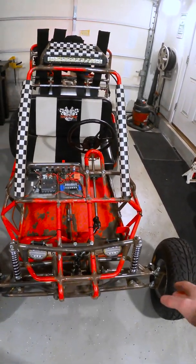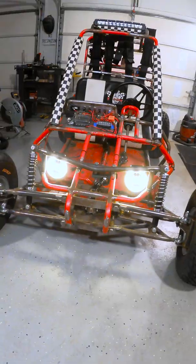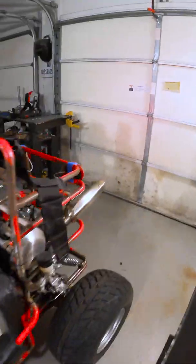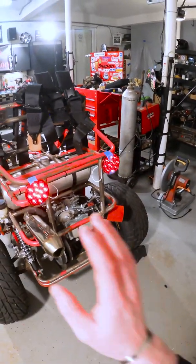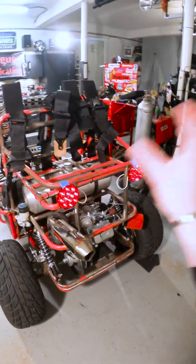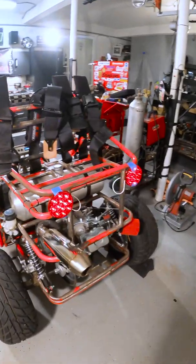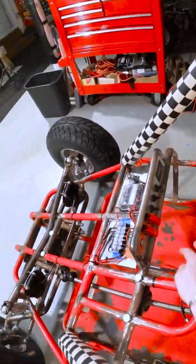The reason our system is a little more complex is because we have these integrated so that I can also turn on just those ring lights as running lights, which look really cool. Our tail lights are also running lights, and in addition to that, when you step on the brakes both of these lights will light up bright. So in order to use our system you're gonna need some diodes and a little bit of intricacy with your wiring.